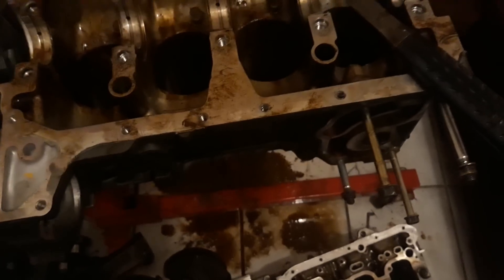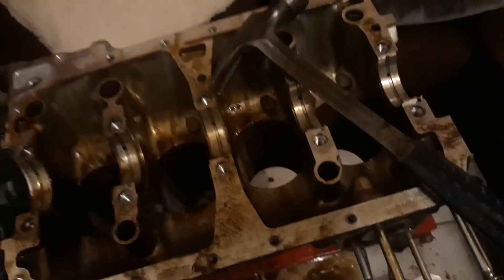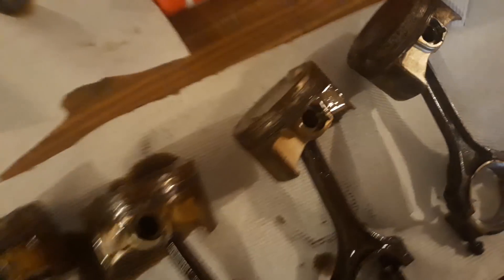I got the girdle off thinking okay, now that I've got the rods free I can take a better look. But first — I'm getting ahead of myself — I took the head off outside and when I took the head off I saw rust, a whole bunch of rust. You can still sort of see from the tops of the pistons, though I did soak them with WD-40. Rust all up in the cylinders — so I'm thinking maybe that's also why it was having trouble turning.